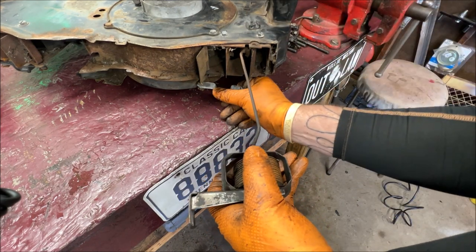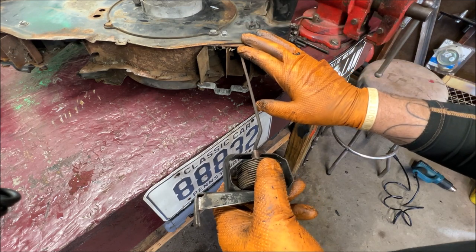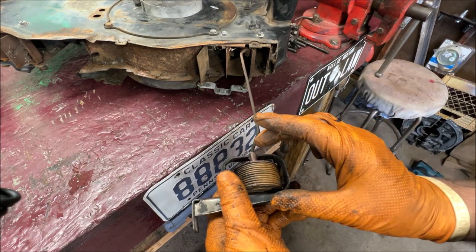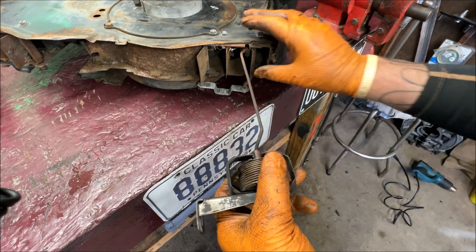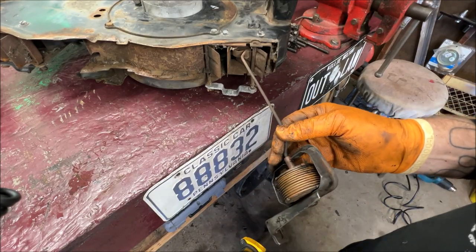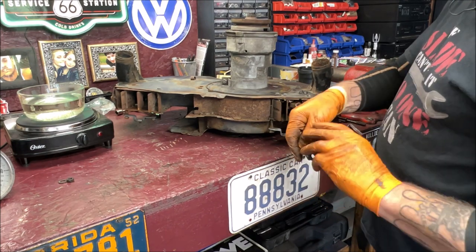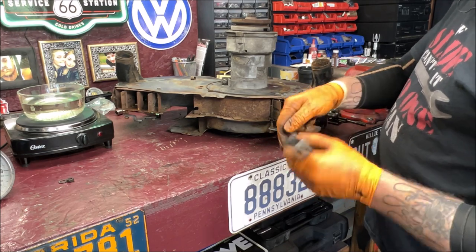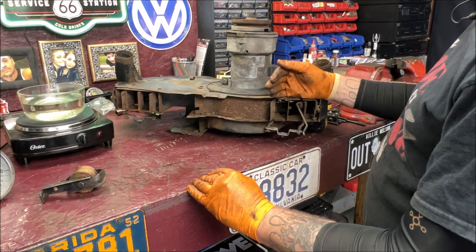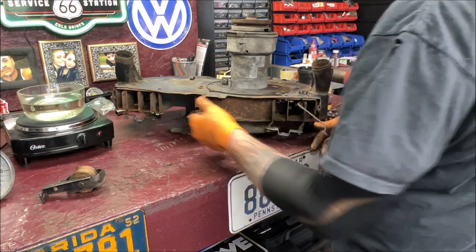When this is opened completely, it's going to continually keep the cylinder heads and your piston jugs cooling down. This will start contracting slightly if it needs to and closes these flaps off, restricting air to let it stay warm. Just so you have the idea, it's on both sides of the engine — them flaps, you should have these on. Even when this is in the full open position, a lot of times they're kind of angled slightly to throw air in a certain direction. There is a bar that goes from here to here with the spring and it controls them together.